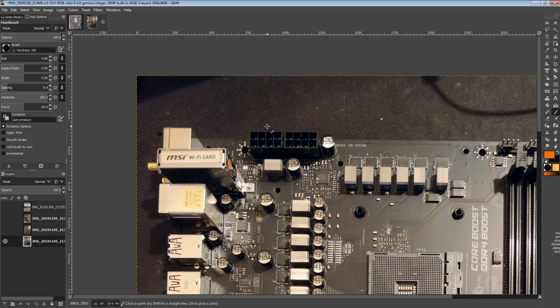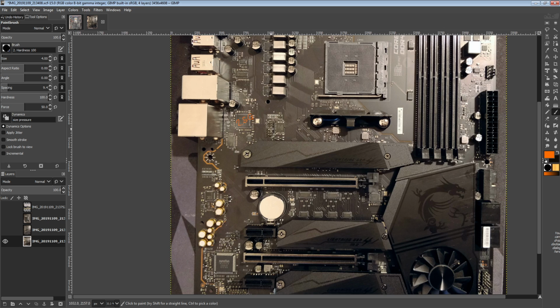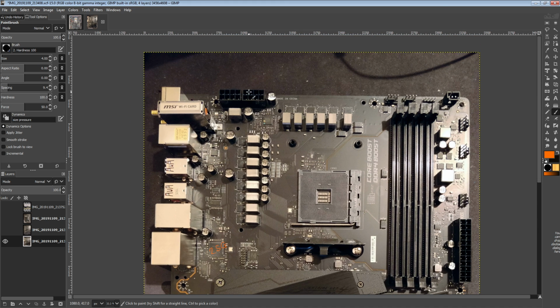Though I really think it would be good if MSI, because I went through their manuals to check if this was a thing, and it doesn't mention it anywhere. Nowhere in the manuals does it say, hey, if you're running quad GPU, especially with the Godlike, because the Godlike supports quad crossfire, at least if you use old enough drivers, it should very specifically say that you should plug in both 8 pins if you're running quad crossfire, because that's where the PCIe slots get their power from. It's a cool feature. You just need to bloody mention it, in my opinion. Like, come on.